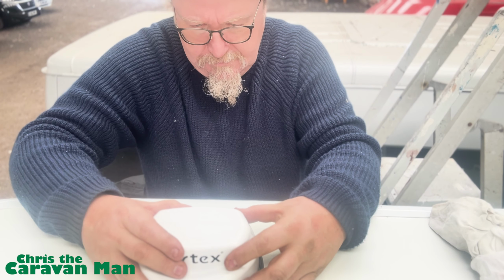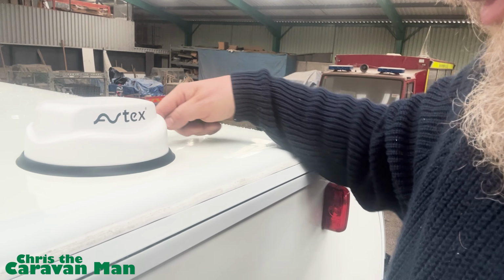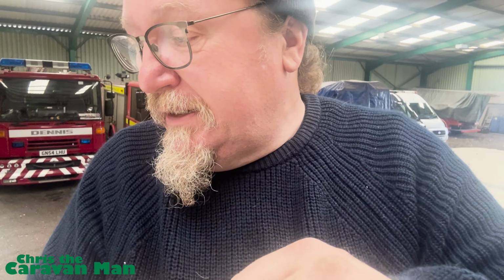she's in. Now, tip for putting this in: when it's in the hole, push it right down, because, I'll bring you in a bit closer, you need this lip here to be flared out as it is and not puckered up. So a good push down gets it nicely seated, and also spreads out the sealant you put around the thread. So quite happy with that.